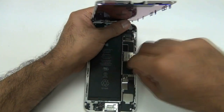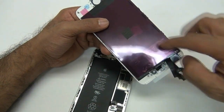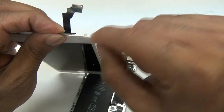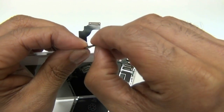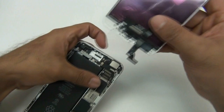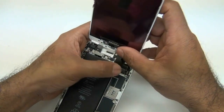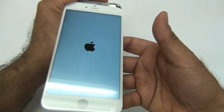Apparently I'm having an issue on this one, so let's disconnect the battery again and look at the flex cable — why is it not working? Looking at the flex cable, it's slightly bent, and that can happen sometimes when you're plugging it in. It's just such a long flex cable that it can bend. It's not that the screen is defective necessarily — it's just that it could have been installed incorrectly. I'm going to try and bend it back one more time, same with that LCD flex cable right here. Even though it's smaller, I've got to make sure it's straight. Push dead center once it's lined up, push it down hard to secure it, push the other flex cable, connect the battery back in — and sure enough, it works this time. No problems.